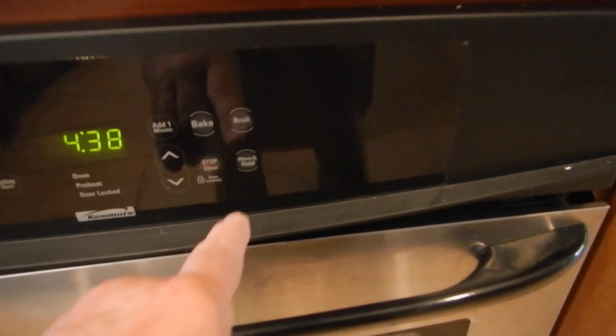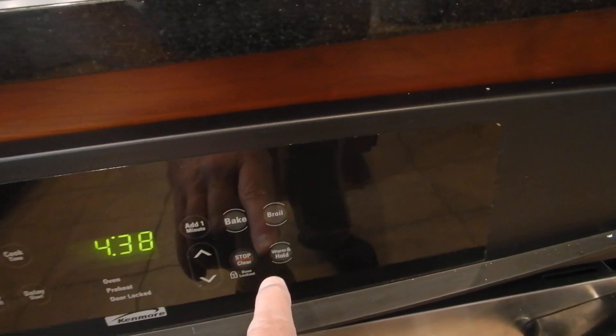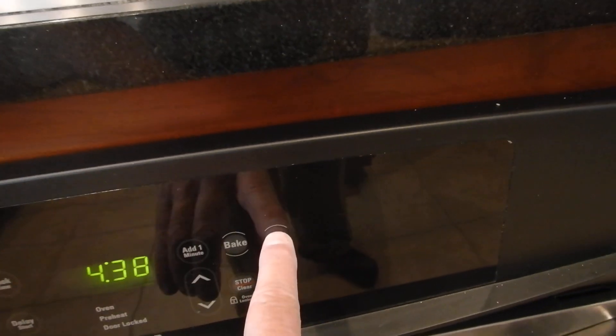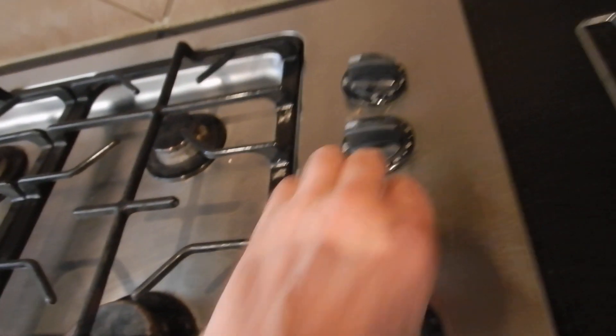The oven - we've got oven lights on. See if I can get the broil to come on - I've had the broil on, I know it works. Cooktop, everything's working fine. But look at that knob - that's kind of funky. Code says that this corner shouldn't be any closer than 24 inches. KitchenAid might have different manufacturer specifications that supersede code.